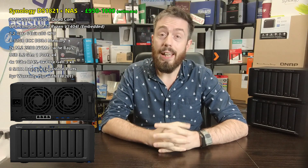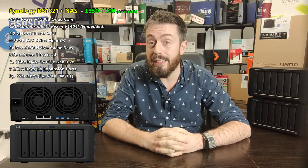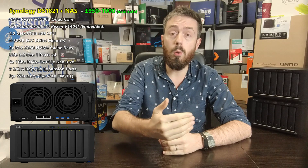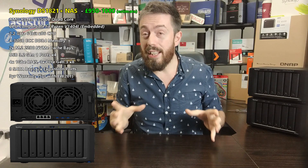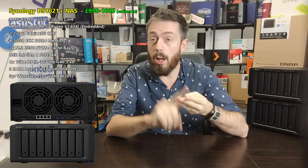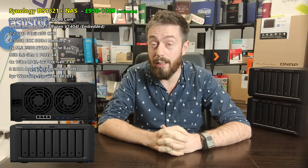This 8-bay solution also benefits from SSD caching. Much like a lot of the new 2020 and 2021 series from Synology, this 8-bay benefits from M.2 NVMe cache bays inside, each of which allows you to install super-fast NVMe drives and bestow their high performance and high IOPS onto the larger, arguably slower, more cost-effective hard drives in the main array. In virtualization, shared drive use, and large databases, that SSD caching is hugely beneficial.